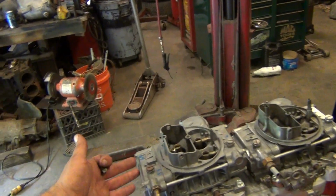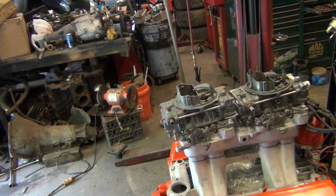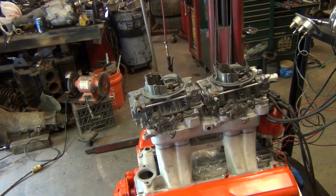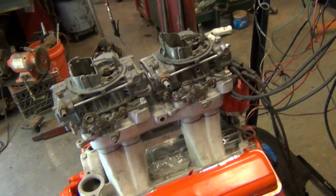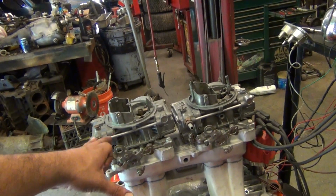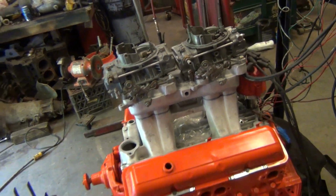It'll enrich in faster. So 64, I think I went 68 on mine with, like I said, 38 shooters and 50cc accelerator pumps, and I had a little bit of a lean spot, but I had a much larger plenum, the larger plenum volume for the TR1X. This is a TR1Y, the street version, so it has a smaller plenum. Mine was probably double the volume of that, so it needed a whole lot of pump shot.